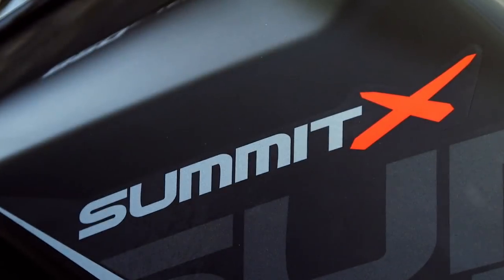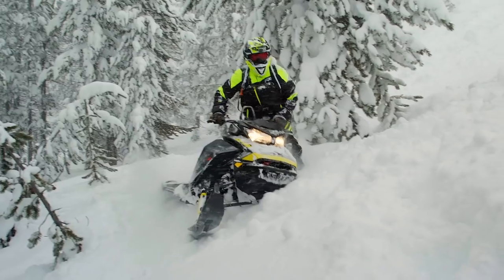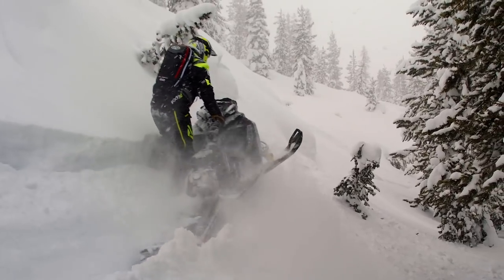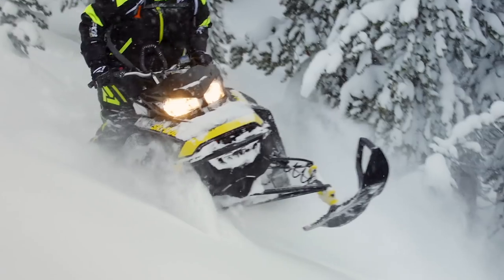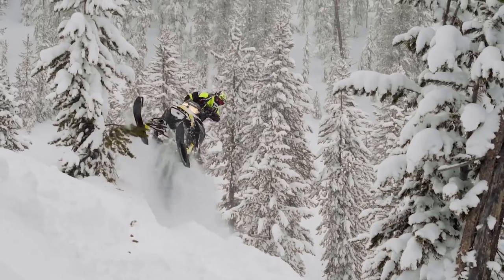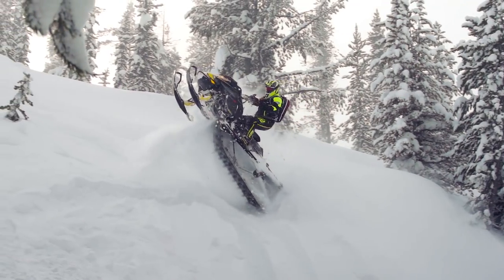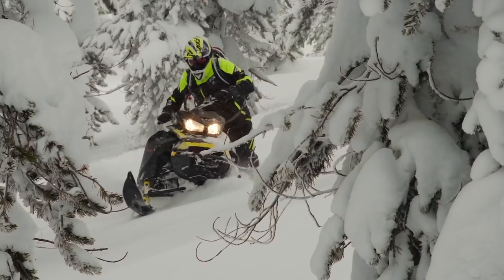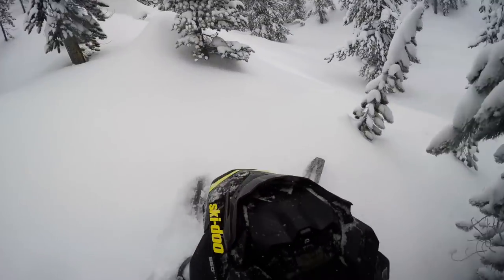The G4 chassis is all-new and pushes the boundaries of snowmobile chassis layout even farther than the XM platform did. To call this one rider-forward would be a bit of an understatement. When the rider stands as far forward as possible, they are standing directly on top of or even slightly ahead of the drive axle. At first this feels awkward, but once given a chance you quickly adapt. The new front end addresses the most nagging issue with the older chassis — the weak bulkhead — and the new setup is strong and durable. T-Motion makes a Summit incredibly easy to get on its side and keep on its side, easier than any other sled on the snow.